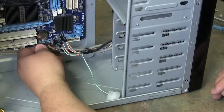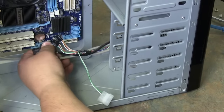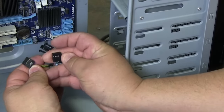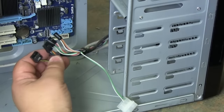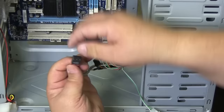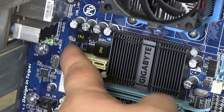These are your USB cables — do the same thing: grab lightly and pull. These do not fan apart, and they have the word USB or the letters USB on them, which tells you these are for the USB ports and the card reader up front. Then this cable — pull from here. It tells you it's an audio port, and it will tell you on the system board where it says 'audio.'